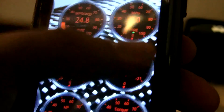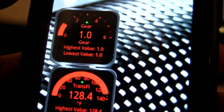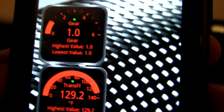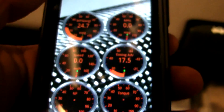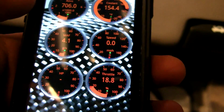There are also some Ford-specific codes that Torque has built in. I can get the transmission fluid temperature — about 128 degrees — and then the gear, so I can see exactly when the transmission is shifting gears while driving. It's interesting that I'm in 5th gear at about 40 to 45 miles an hour. So that's pretty much Torque. It doesn't show everything it can do without 3G, but for my purposes it's pretty neat.